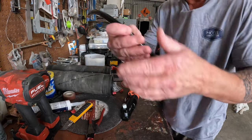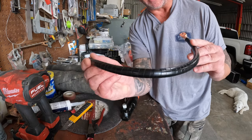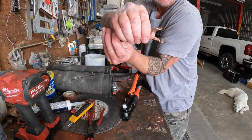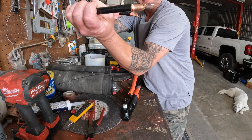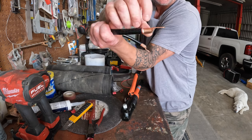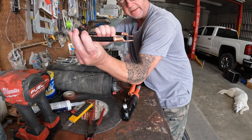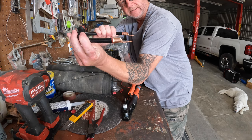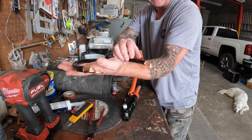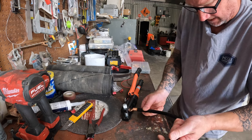This is going to sit on the battery and bolt to the post. You want to make sure your lugs are phased — see what that lug's doing right now? That's not phased because one's this way and the other's the other way. You want to rotate it so they're both in phase with each other, just like that. That way you don't have to try to twist the wire and make it go somewhere it doesn't want to go — you want it to just rest naturally.